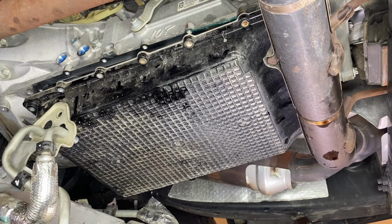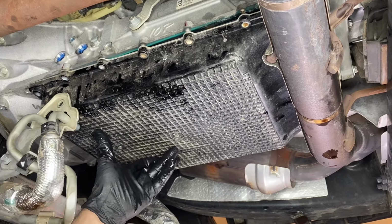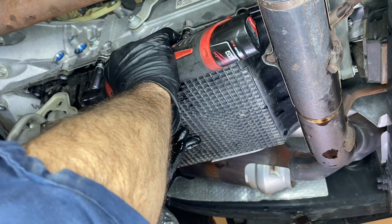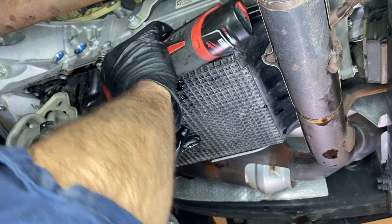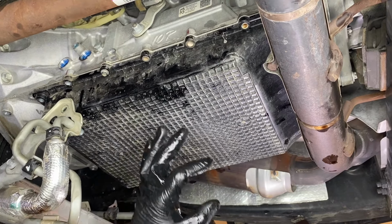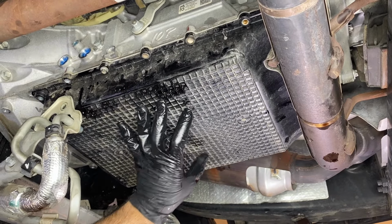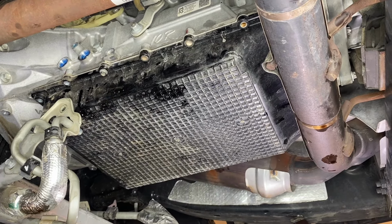All right, now let's go ahead and start adding our bolts in. Just remember where your marks are for your studs, for your heat shield. I like to get the bolts just finger tight. That way, if we have to move the pan around a little bit to accommodate other bolts, we can.